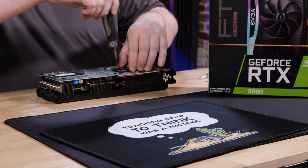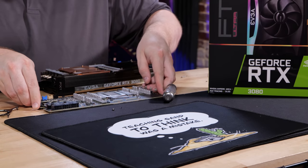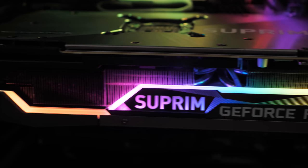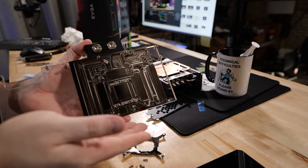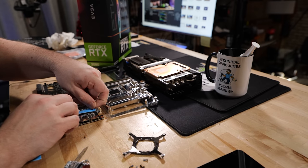This card is a monster for the 3080 — it's a bigger-than-usual card and it literally will not fit in the NCASE M1. The NCASE M1 will hold a 3090, but unfortunately my 3090 died due to GDDR6X overheating and I'm working on getting it repaired. It's really hard to get GDDR6X. But ironically, you can actually put a 3090 on a water block more easily than a GPU like the 3080 FTW3.